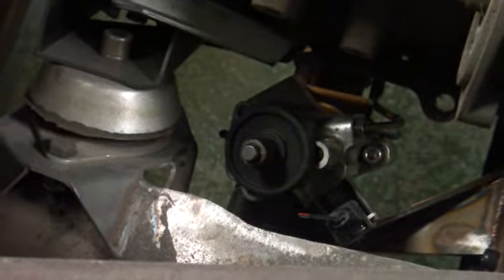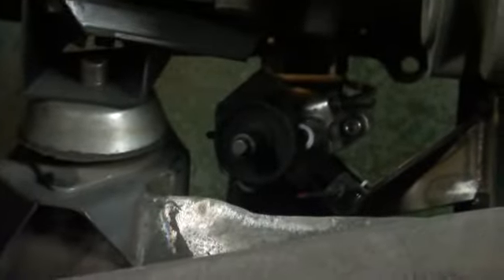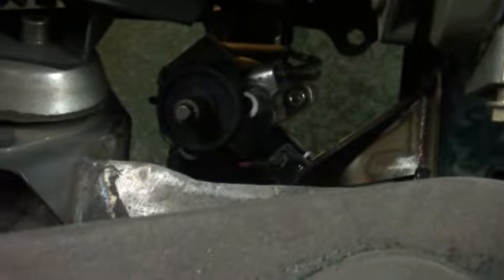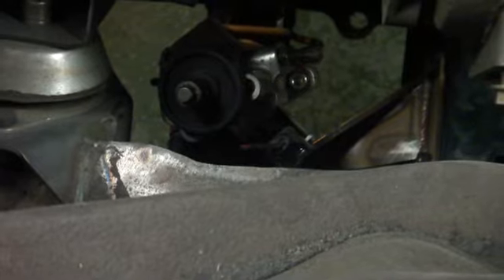The reason it's caused me a little bit of problems is that normally the engine mounting bracket would have been that side of the rack. But because I moved the engine back 8 inches, as you can see I've got a lot of space there. We put the engine mounting bracket in the way, so even though I could bring the rack out quite a ways from the cross member, it still left me a bit of a problem with the tie arms. I'll show you when we get underneath.